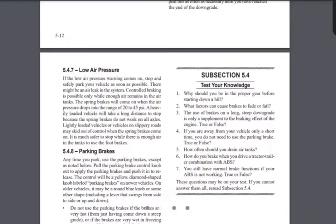What factors can cause brakes to fade and fail? Overheating and being out of adjustment. True or false — the use of brakes on a long steep downgrade is only a supplement to the braking effect of the engine? True. Your service brake should not be your primary brake going downhill. The low gear you downshifted to and your engine retarder or engine brake are your two primary brakes. You should press the service brake only periodically to give your brakes a chance to cool. If you stay on the brakes without letting them cool, they'll overheat and you'll get brake fade and failure.